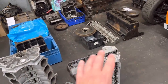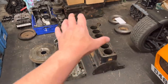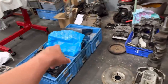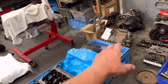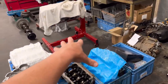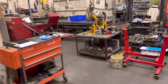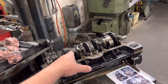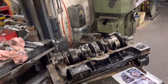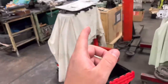We've got a stack of work down here — we've got this Rover V8 which Paul Dove came in on Wednesday and very kindly blasted and cleaned up. This was in a right old pickle, so he spent most of the day on it. Now Paul's done all the cleaning, I can get this block faced. He's already cleaned up the valves, so I'll soda blast the ports, cut the seats — he said the guides are okay. We've also got another 4.2 Jag engine here which we've got to do some machining on. We've got a Volkswagen here — we've got to bore it plus 2mm, there are some JE pistons over there, the rods to sort out, and we've got to fit a cradle plate on the back of the block. I love that sort of machining work, it's in and out. The Sunbeam here, which John has pretty much finished — we've had to have rods made for it, big job, but only the short engine left and that's pretty much done.